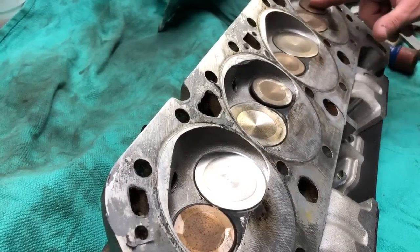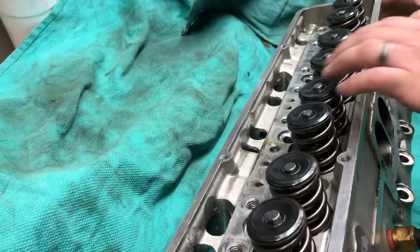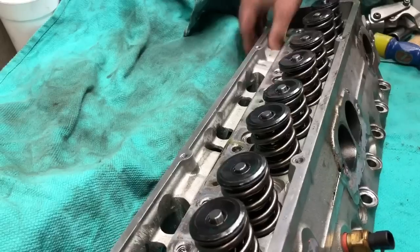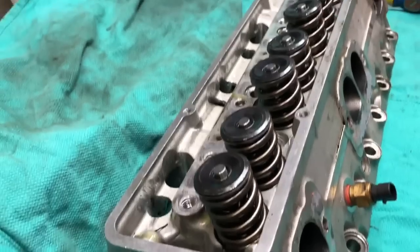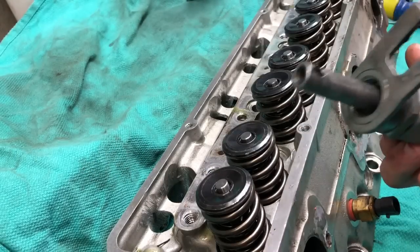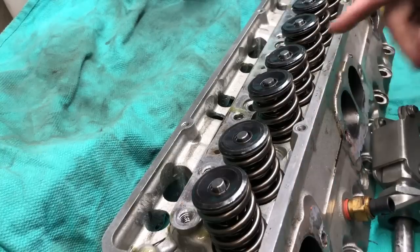I'm going to show you how to take the valve out and take the springs off real fast. You can see methanol is pretty rough on some of these chambers — that's why we run top lube. I'm going to flip this head over real fast. Try to get everything on a fairly smooth, clean surface so you don't have to worry about damaging the surface of the head. Overall, this is pretty simple to do. This is the tool we use — you can buy these off Amazon, Summit, or Jegs. It's the best thing since sliced bread. It has a 7/16ths on one end and 3/8ths on the other end — you can reverse it depending on your stud.